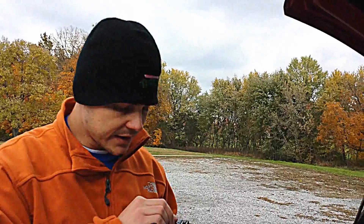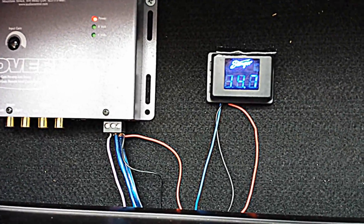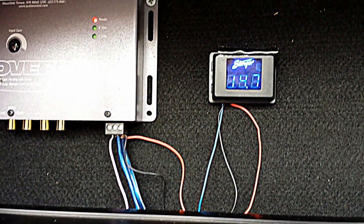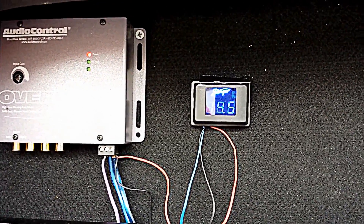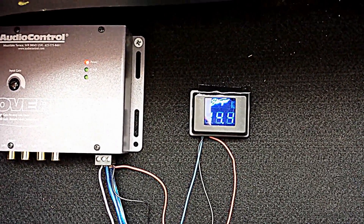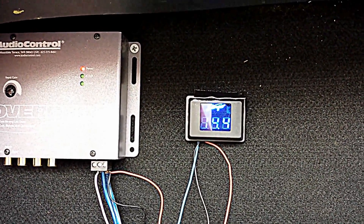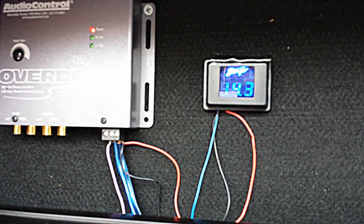I just built a really big bank and took a lot of the series resistance out of it. This is all four-gauge wiring and everything, so I have a more robust system than most people. But once they drop, they drop — they don't come back like a battery. So we don't have a lot of reserve. I happen to have more than most people. But right now I'm going to go ahead and shut everything off other than the amps so you can just watch the idle current drag them down — and it does it pretty quickly.